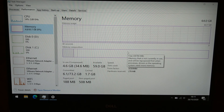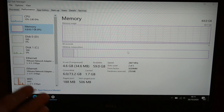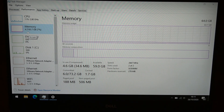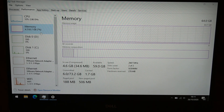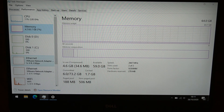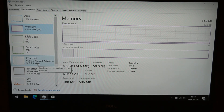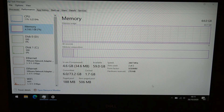The installation has gone successfully. If your RAM is installed properly you'll be in Windows and can see the free memory exactly like this. At the moment I'm using only 4.8GB of the 64GB doing essentially nothing. As for why 64GB — I had only 16GB before and I like to run Linux virtual machines, where the extra RAM definitely helps. I hope this helps you upgrade the RAM in your laptop. If you like this video please subscribe, and if you have any questions feel free to ask. Thanks for watching — see you in the next one!